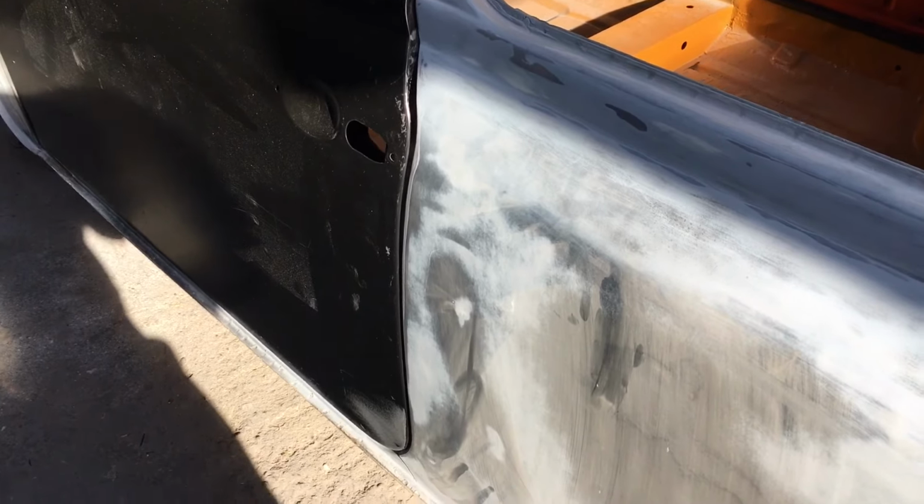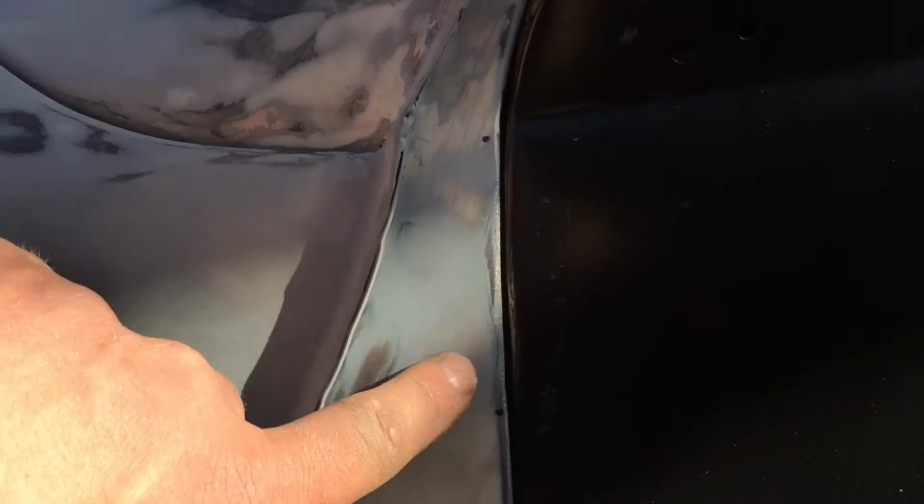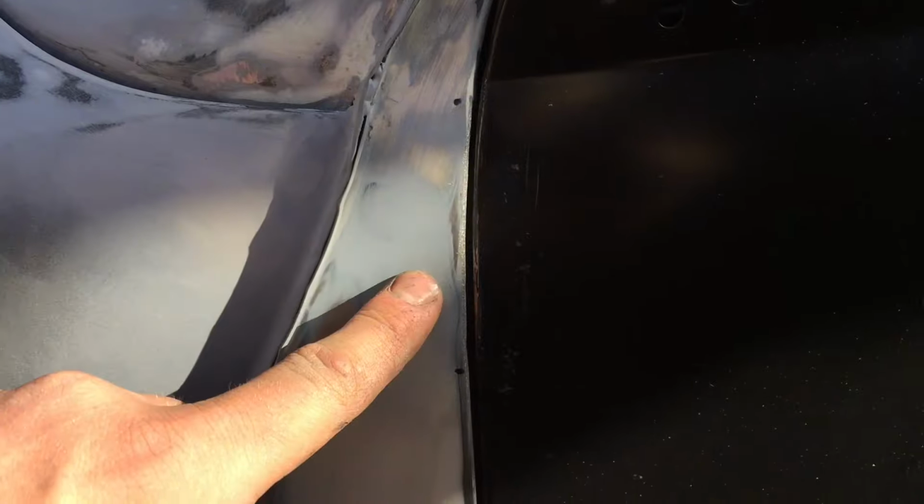But yeah, this one opens and closes really nice. The only thing I had to do on the passenger side was, you see where I've got these markers here? I just had to basically hit that. And I've got Mark Draper to thank for that. I saw him do it on the RA. Now that line all the way down is completely the same, and I'm so happy with it. Where I marked that was where it was just a bit too tight. I mean, the door was clearing it, but it was just a bit too tight. So I literally hit it with a hammer, tapped it back,